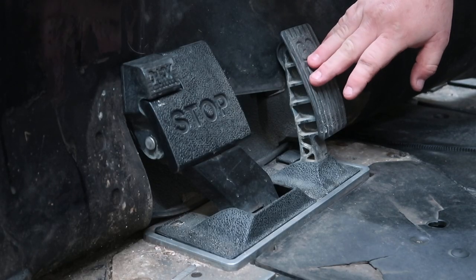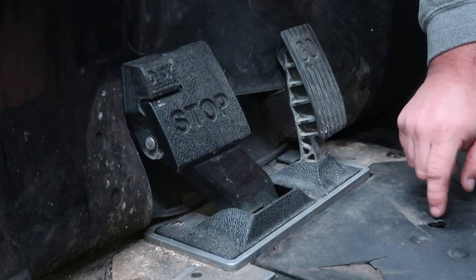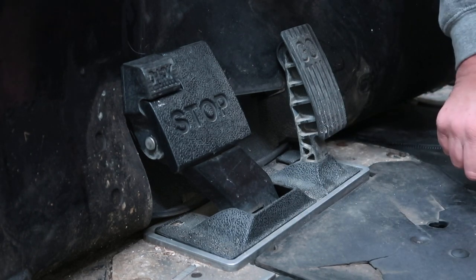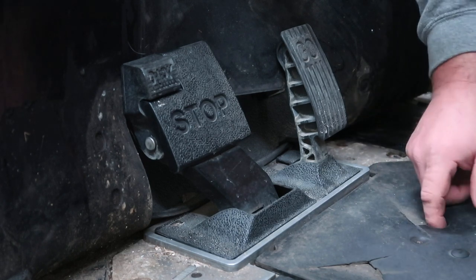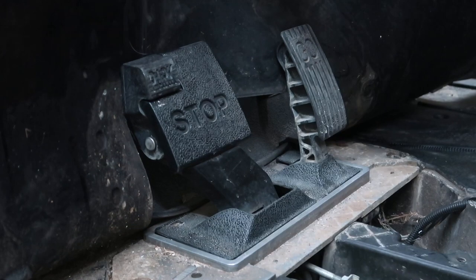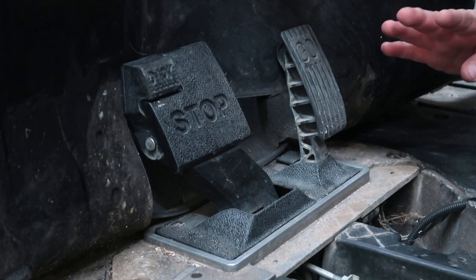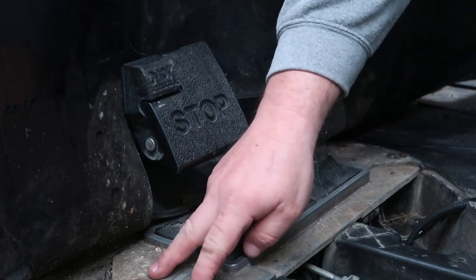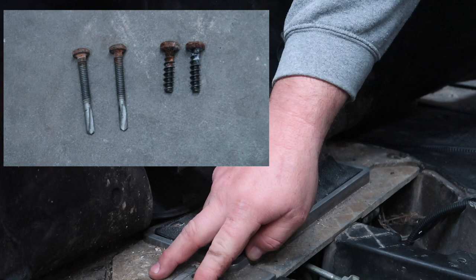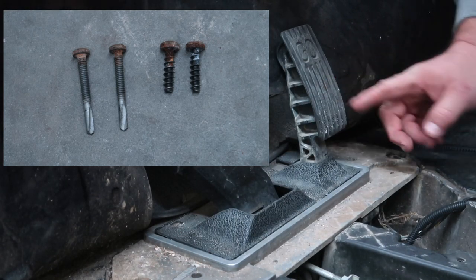Now when you are removing the pedal group from the golf cart, this is a plastic piece right here. It has a finger hole where you just put your finger in there and pull it up. It's going to be a plastic Christmas tree that will probably pop up as well. Now in order to remove the pedal group away from the golf cart, there's going to be four Torx head screws we need to remove — two on the brake side, which is the driver side, and two on the passenger side, which is the accelerator side.